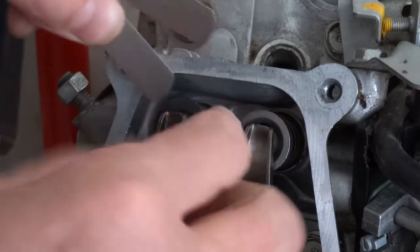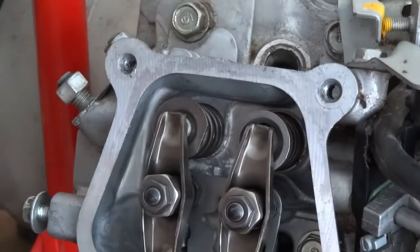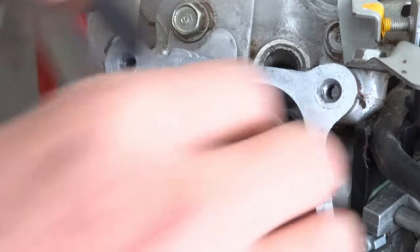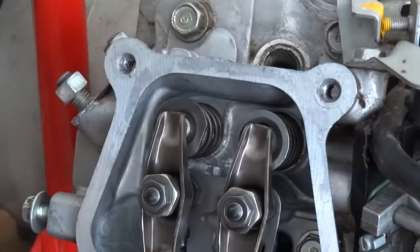The exhaust is 0.2mm and it is just about there. These ones aren't bent so it's harder to get them in. Well, could do with loosening off a bit. And it's 0.15mm for the inlet side. Yeah, that's perfect. These are both set pretty perfect.